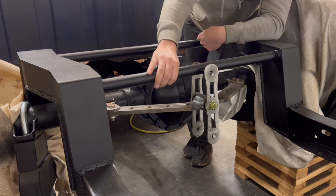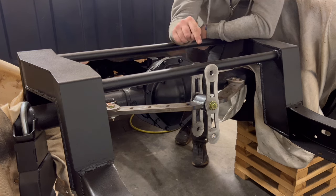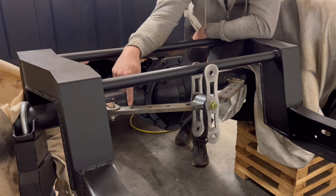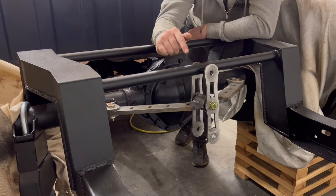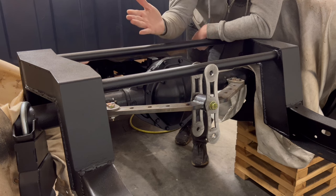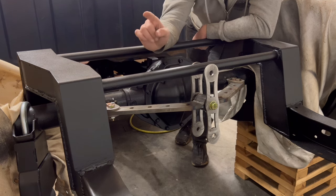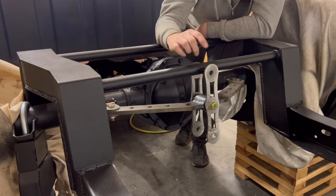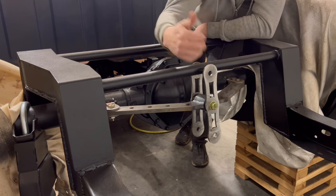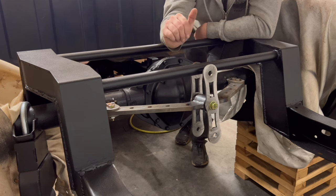But I really like the double bar — it looks great and makes it more structurally sound. This is how cool it is to work with a small business: I sent Alex V a picture of what I had going on, because this is the first truck with a monster step notch that lays out to have this setup installed. Alex has had a lot of people on square bodies and some with a mini notch install this — with a mini notch, the frame would be further up and the bridge wouldn't be here, and it works perfect. But on a monster notch it needs a different design. I asked Alex if he could make the brackets seven inches instead of ten inches — that would take an inch and a half off the top and bottom — and he said give me a day and I'll ship you some.